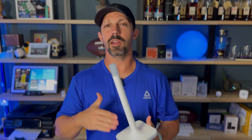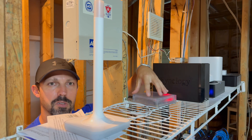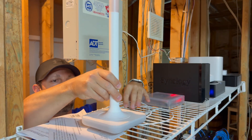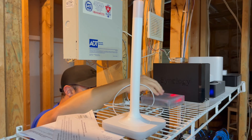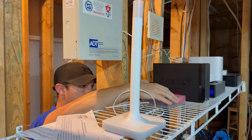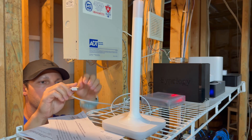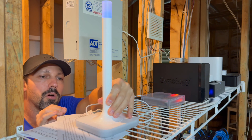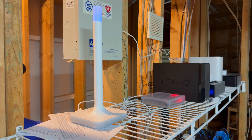They've made it very plug-and-play, so let's see what it's like connecting this to my Home Assistant hub. I have my Home Assistant Yellow, which I run Home Assistant on, and the ZWA2. I'm going to take the USB cable that was included — USB-A on this end — and plug it into the back of the Home Assistant Yellow. The USB-C end goes into the ZWA2. In theory, it will be automatically discovered via Home Assistant. You can see the light on top is flashing.